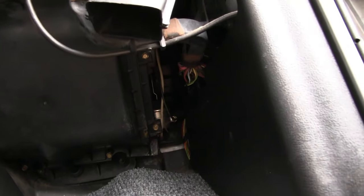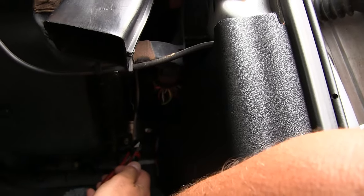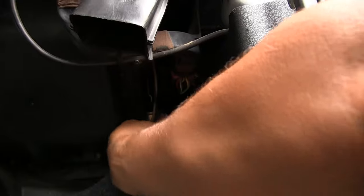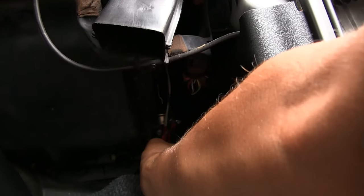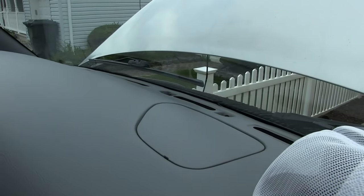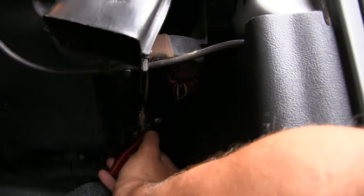The next step: down by the floor on the passenger side compartment next to the doghouse, we have to locate the black vacuum line. It might vary in color depending on your model year. There are two lines here — this is the one that comes from the accumulator that's bad, and we're going to utilize it by cutting it. You could also, before you cut it, check the little access panel on the top of the dashboard — take it off and you can see that black line go into the valve assembly. I already know this is the one, so I'm just going to cut it.